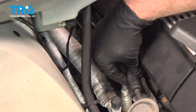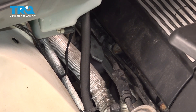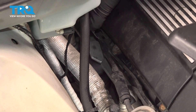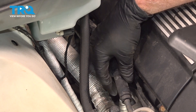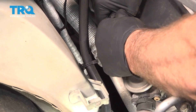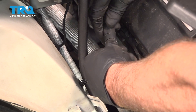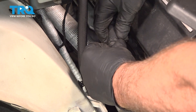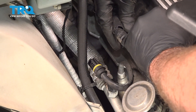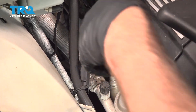There should be a clip holding the connector in — this one is missing. If you look at the back, you just pull the connector out. The procedure for the back O2 sensor is going to be the same as the front. There is a little lock on here and here. You can try just pulling that apart. If you need to, just use a straight blade screwdriver and try to separate that a little bit. That's disconnected now.